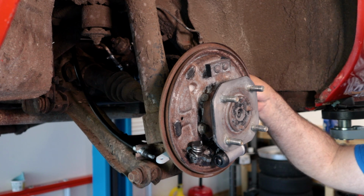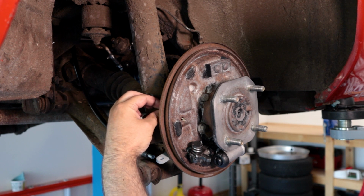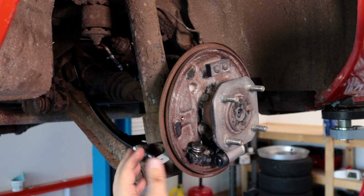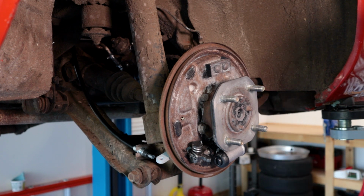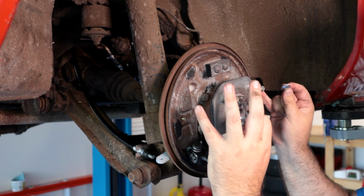And basically there's a hole on each side of the, now this one you have to kind of wiggle it in from the top, and this one's a little more interesting to get in, but I like to go ahead and get them in place and then just pull them back to where they're not going to be in my way, but at least they're there. Because once I get the shoes on, I'll go ahead and use the first washer and put them on, and that'll hold everything so I can take my hands off of it.